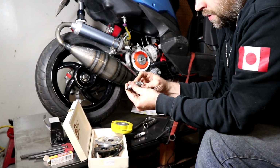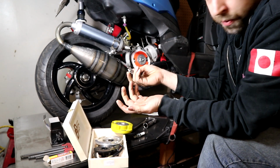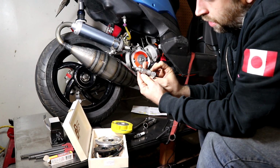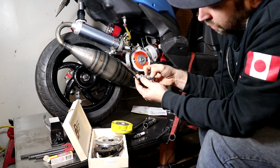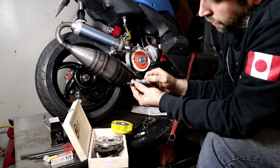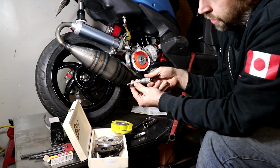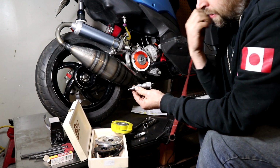Well, this is a micrometer for setting a piston stop, basically. So this turns in and out. This one is a Bazzetti, I think. I don't even know, maybe just a Moto Force. But it has graduations all along the thimble here, similar to a micrometer. So the thread on the inside, which I have checked on this one, is 1 millimeter pitch. That means for every full turn of this back to zero, you have 1 millimeter of this moving in.